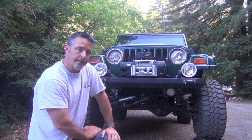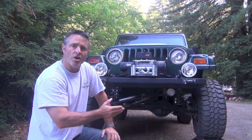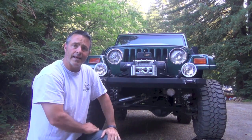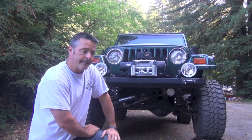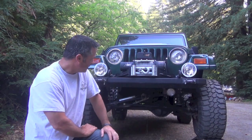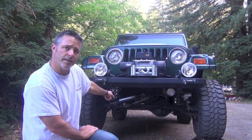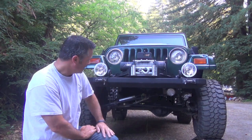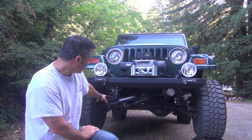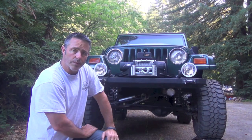That helped out a little bit. Prior to that, we measured the rear axle and found that it was about 3/4 of an inch offset from the back. So we cleaned that up because it was actually pulling me to the other side of the road. Got that taken care of. Still had the wobble. So then, and this is a spring lift, I ended up putting in a new steering stabilizer, a new traction bar, and made sure all the ball joints and all the fittings on this were tight. They were. Still had the Death Wobble.